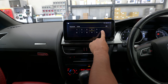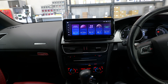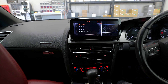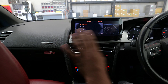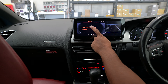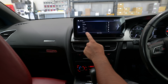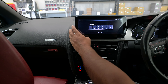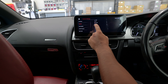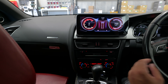For the old 4G-style user interface: go to settings 1314, scroll down and select UI 4G, then turn the car off, let it sit for a minute. While waiting for Android to reboot, on the original MMI side go to Source and External Audio will already be pre-selected — you don't need to plug anything into the AMI, as new coding handles that automatically. When it comes back you'll see the classic wheel-style UI. You can also go into settings 1314 under Vehicle and change the car model — A4, A5, S5 — to customize the display.